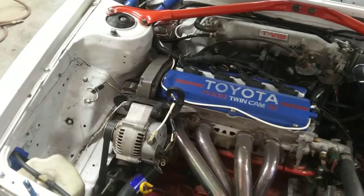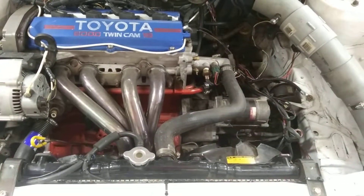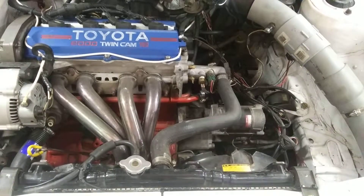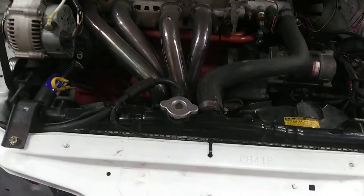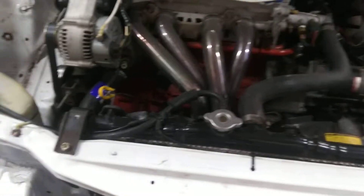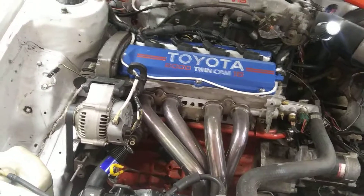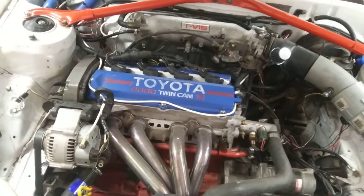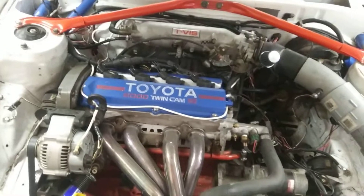It's worked pretty good so far. It's been reliable besides one spark plug failure that we had two weeks ago. It just bolts right up to that '93 Celica transmission and away we go. It still has the factory Toyota 13-pound radiator cap and overflow tank, so I was thinking of upgrading that to either a beefier radiator or I might try just a TRD 1.2 bar cap first.